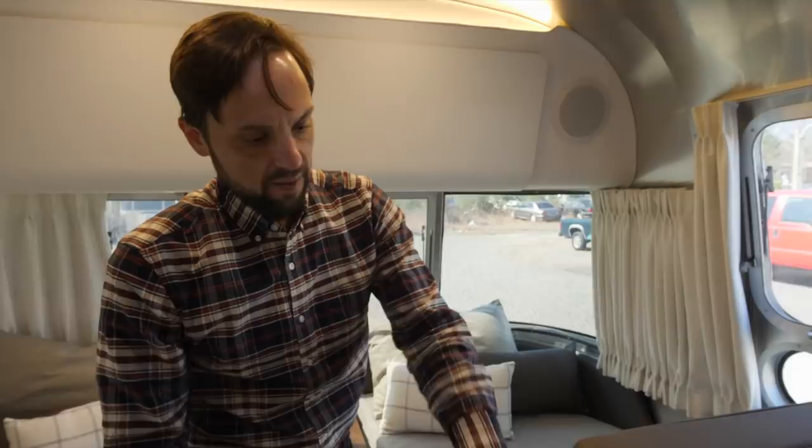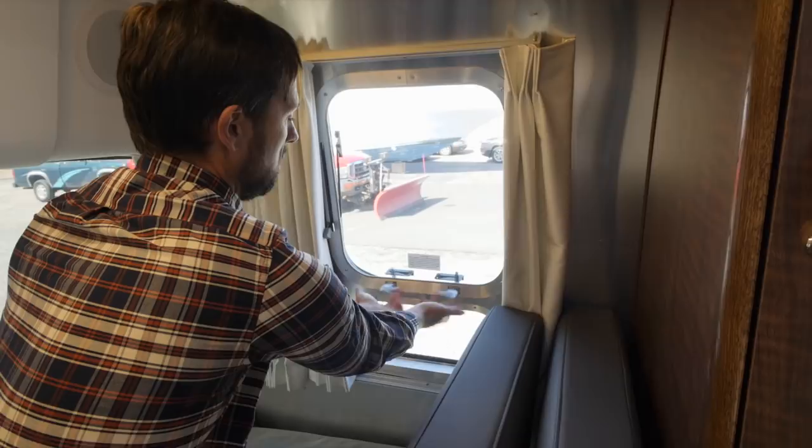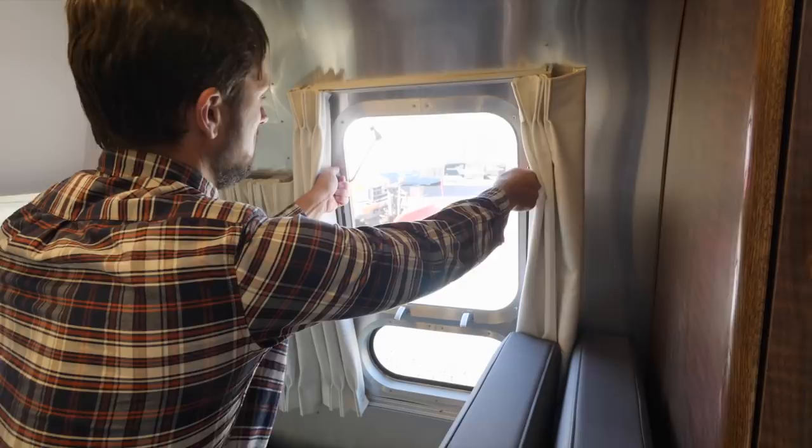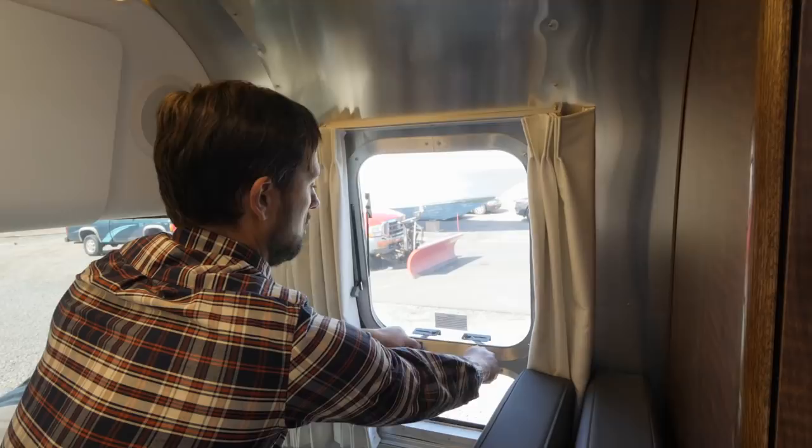The window is an 18-inch stacked window — stacked because it has a porthole in the bottom. It's all safety glass and tinted. Just pull the two handles, twist, and lift evenly with both hands; it snaps into three different heights for adjustment. Before you tow, make sure to twist and lock them in. There's an Airstream Care app and a manual that gives you a checklist of things to do before you leave the campground.